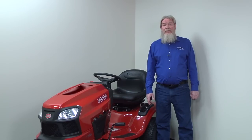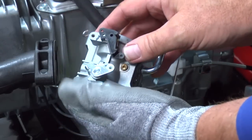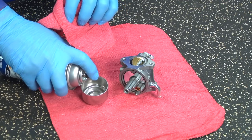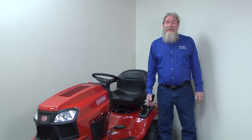If your engine has a fuel pump, replace the pump if it doesn't move gas through the fuel line to the carburetor. If you found no problems when checking these fuel system issues, then rebuild or replace the carburetor to restore fuel supply to your engine. If your engine didn't start with the help of starter fluid, check the ignition system.